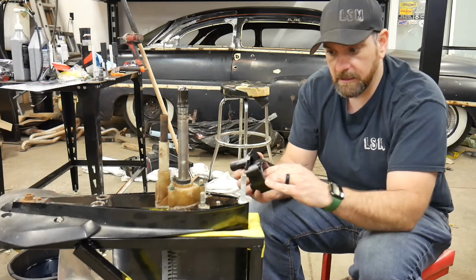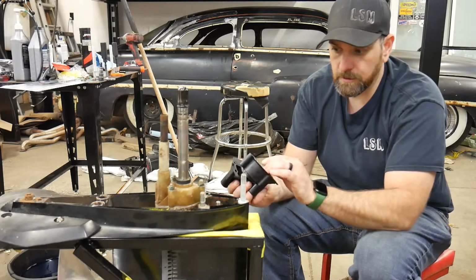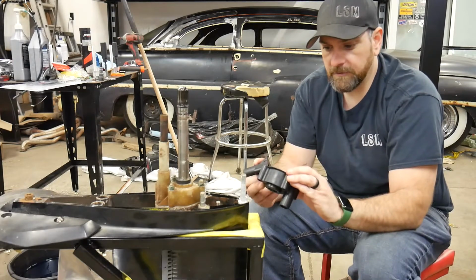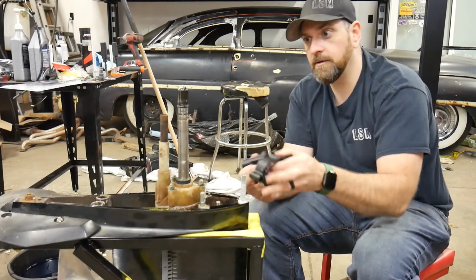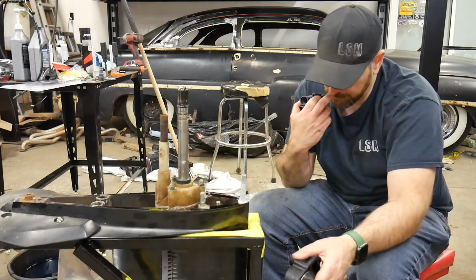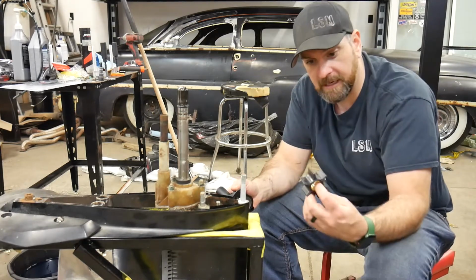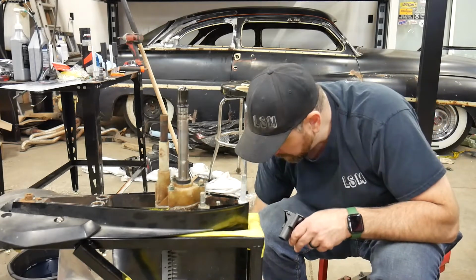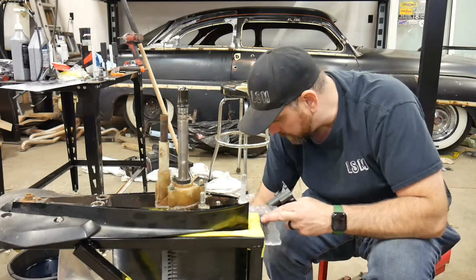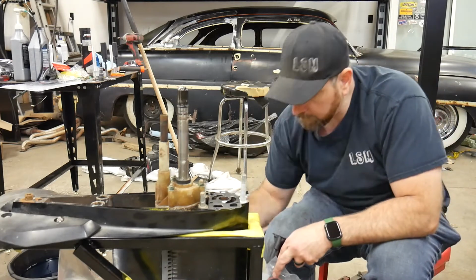around like that, because if this ever spun, what's going to happen is it's going to cause a big issue, because this is actually offset in here, and if it spins and gets cocked in the wrong way, you can actually cut into your drive shaft here, and anyways, it's just bad news. However, I do like the impeller from this one, being that the impeller is brass. So this Quicksilver one also comes with all your different gaskets, O-rings, the base plate for the bottom, your little plastic tube,